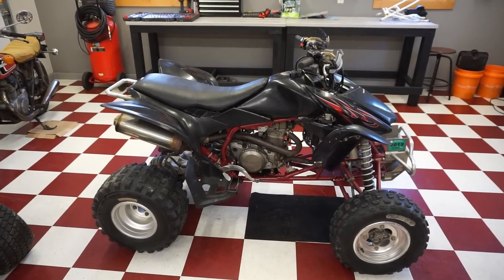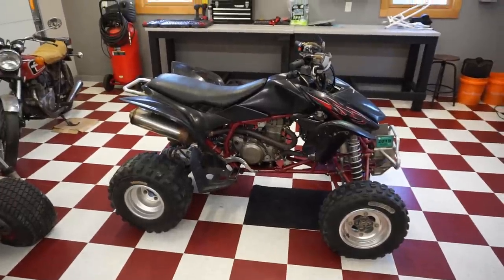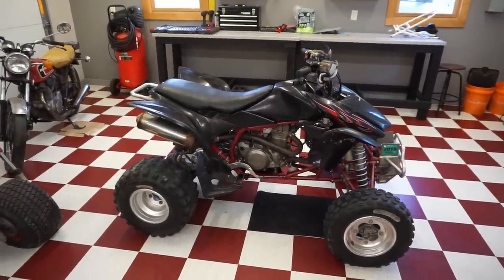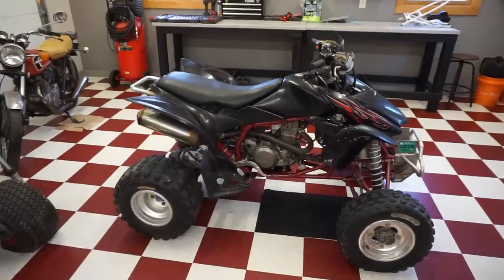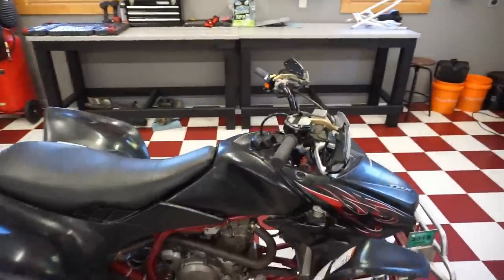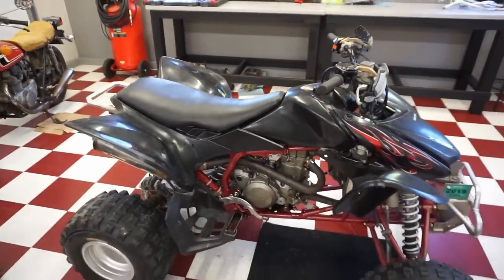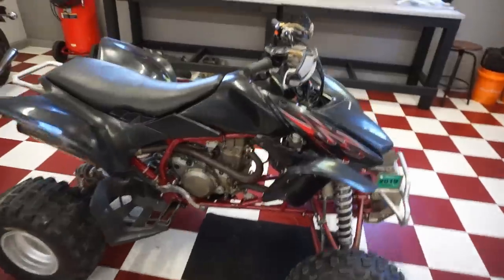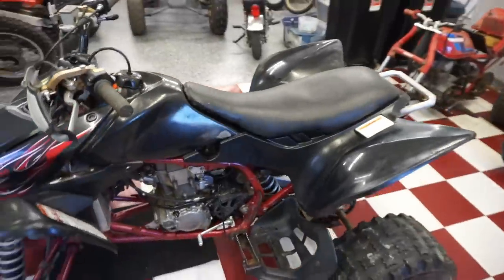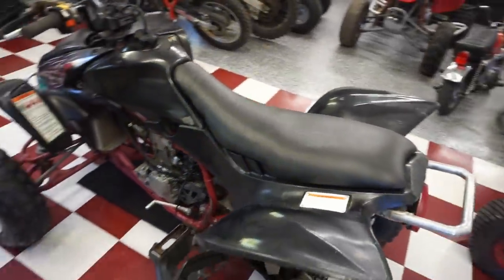I'm not really quite sure what it is. It's a mystery. So if anyone has any idea, leave a comment down below. If you've ever experienced something like this with the TRX 450s, this one's a 2007. So it does have the throttle sensor on it, a couple of them on the carburetor. So it's just a pain to deal with. We've checked everything. Everything checks out. So I'm leaning towards either carburetor or that rod bearing.